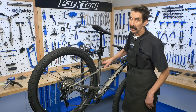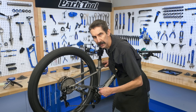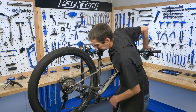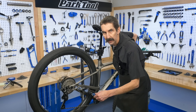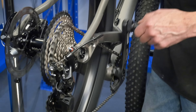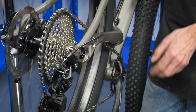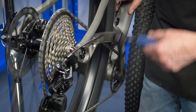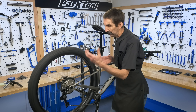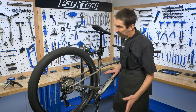But you're also going to pick up some issues. Here we get a really nice clattering noise — it's just going to be noisy. We come out a few gears: quiet, nice and smooth. The chain is dropping straight onto the front ring. But because we have a large differential, we're just going to end up with that clatter. Not so great on chain wear, makes a funny noise. Big deal — it ain't really broke, don't need to fix it.